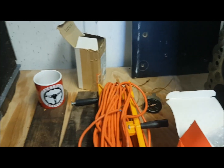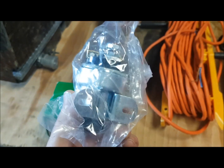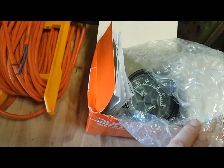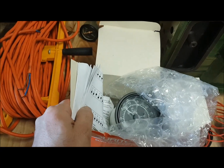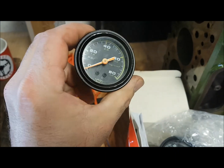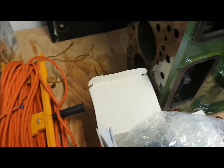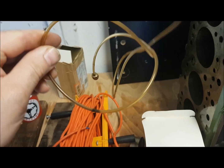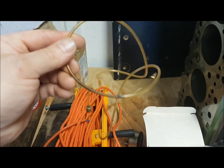Things you will definitely need, if you don't already have them: you're going to need a starter solenoid to start the engine — this will actually be going into the car, so it isn't a wasted item. It's a good idea to have a rev counter so you've got some idea of what the engine's actually doing RPM-wise. I bought this off eBay — I think it was something like 30 quid, but it is second-hand new old stock. An oil pressure gauge is a good idea — this is a mechanical one, apparently working when it came off the Jeep. It has an oil line with what I think are BSP fittings, which might marry up to my block.